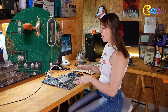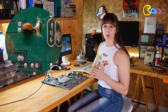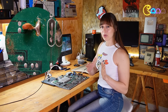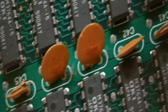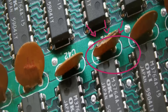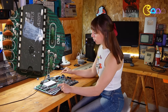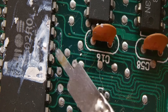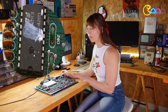I don't know what kind of repair was done on this Commodore. I just know that it was sent to repair a couple of weeks ago, and then the previous owner noticed something was wrong because a few screws were missing on the back and also the power supply is making strange noises. I also noticed this capacitor over here — it's completely broken, I'll have to replace it. And also this one over here snapped on the tip. I also want to replace the old thermal paste on these chips because it's dry, and on this chip it went a bit to the side so I'm afraid it can make contact. I'll clean the old one and replace it.